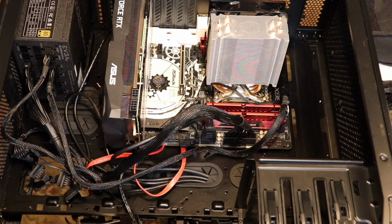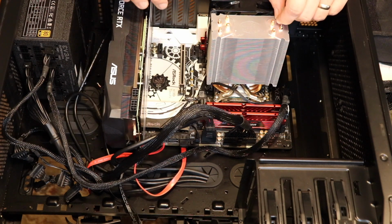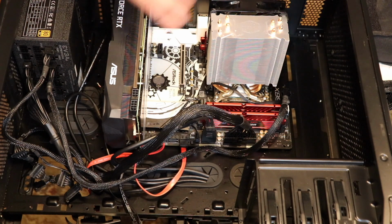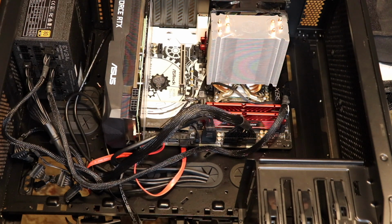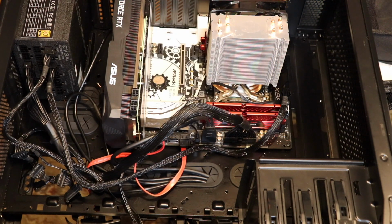Now, lately, not all computers are beeping. Some computers don't beep as much anymore, but that's called the POST. So if you get to the screen that says press delete to enter setup menu, that means you're already past POST and your computer is able to turn on. Okay, gotcha. Now, I've done the CPU power and the master power for the motherboard.